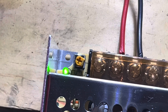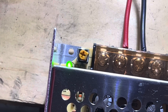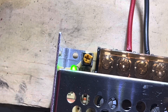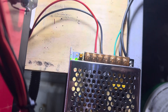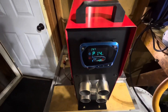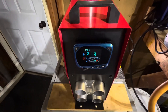Out of the box it was 12.6 volts. If you turn this pot clockwise with a Phillips screwdriver — it doesn't take a lot of force, a small screwdriver is really all you need — you'll be able to turn the voltage up. The maximum voltage is 14 volts, and 14 volts is certainly better than 12.6, especially since it makes your combustion fan turn that much faster. If you're seeing 12 volts when you connect this power supply, by making that pot adjustment you can get closer to 13 or 14 volts.